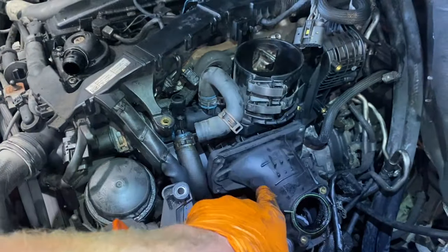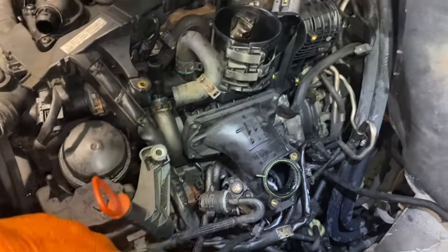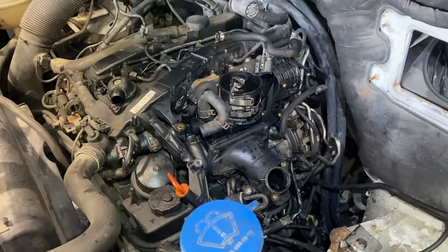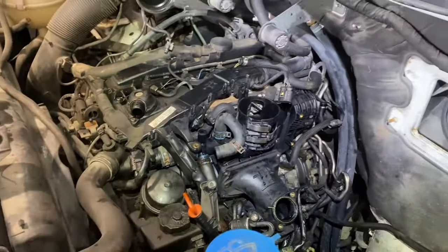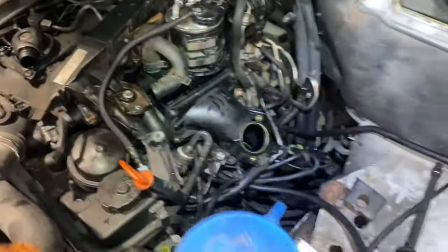Fuel filter housing is sitting back in place. I didn't get a replacement gasket for the throttle body down there, so I put a little sliver of sealer on it and threw in a couple of bolts to sit on the throttle body. Then I can start rolling back and looking at the EGR coolers. It's actually a horrible job to be honest - bits of plastic everywhere, everything is flimsy and a maze of stuff. Doable, but just horrible if the truth be told.